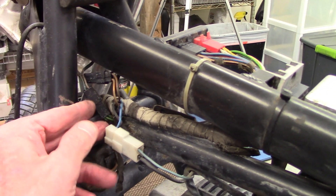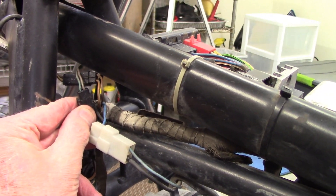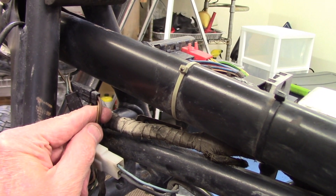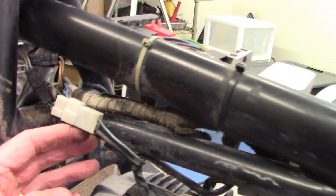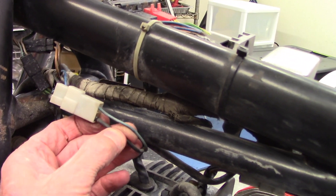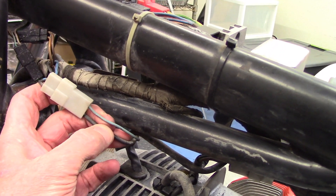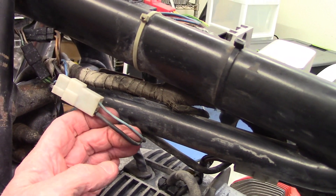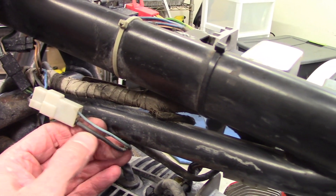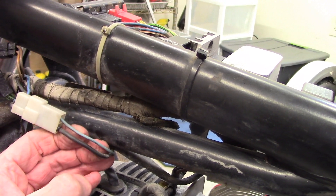Up front here are a couple of small plugs: this one has the brake light wiring for the front brake light, and then this one has the clutch wire for the clutch switch. There's also a large white connector with a blue and black wire. The blue wire goes to the alternator rotor and to the dash light for the gen light — it provides power to the rotor so the alternator can work from a dead stop. The black wire goes to the starter relay and helps energize the solenoid and the starter motor.